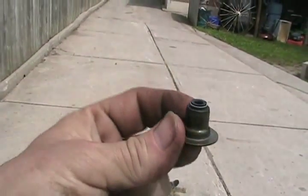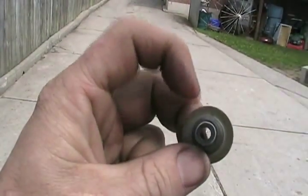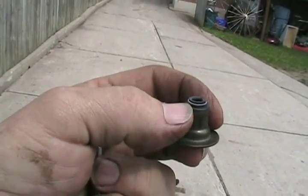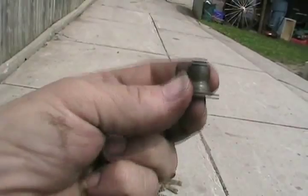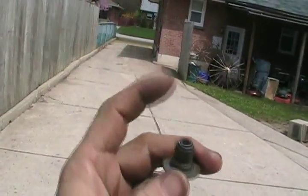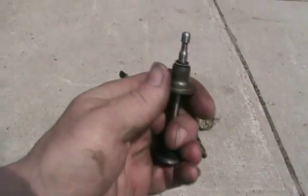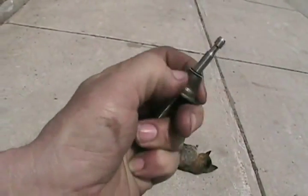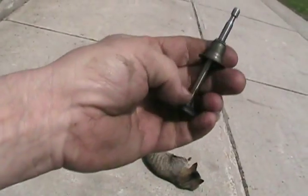The other type of oil seal, which is more common on modern vehicles, has a metal cap — it doesn't always have to have that ridge. It's always got rubber or neoprene on the top, and a little spring to grip it and give some tension on the valve. It's pressed on to the top of the guide, which is sticking out of the head, and it stays there until you need to replace it. The valve just slides up and down, it grips the shaft, and it prevents the oil from running down the guide.